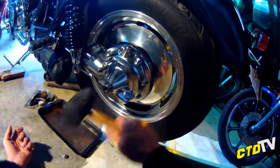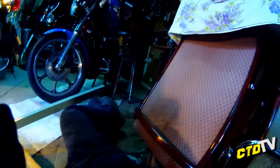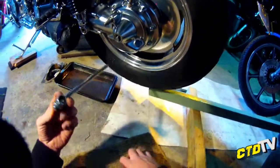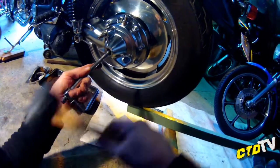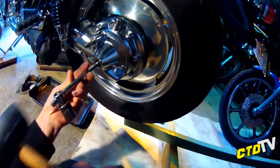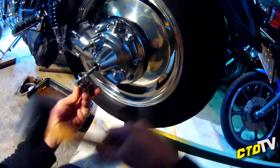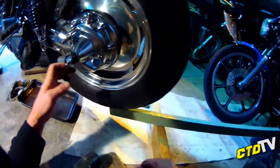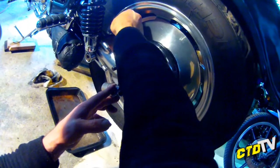But when you're at a point to take it off, you then get the T-bar you use to take it off with. Hopefully that bearing ball won't be a problem. The diameter of most of these T-bars is quite skinny, so as I'm knocking the axle out, it's being replaced. Where's the donk? There's the donk. It's been replaced by this, which is a lot thinner, and as you can see, it can fall out by itself. Oh, by the way, quick side note. Grab a pan drip tray, just in case your diff might drip some oil.